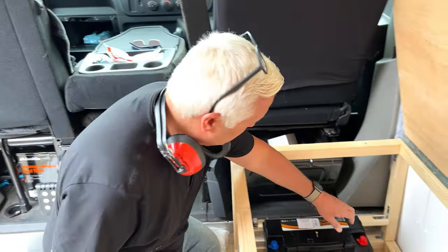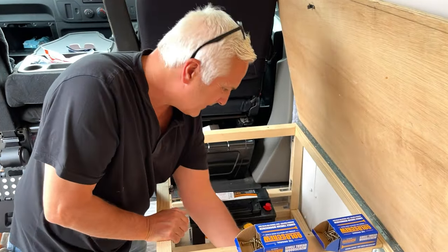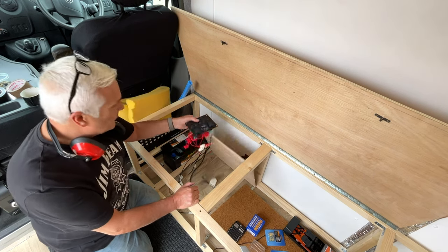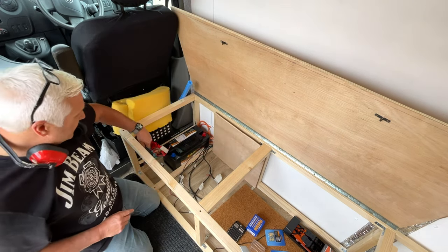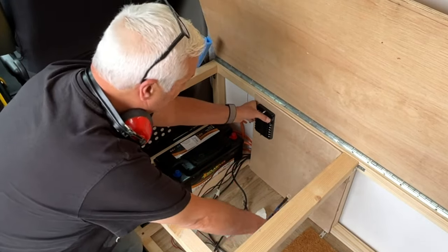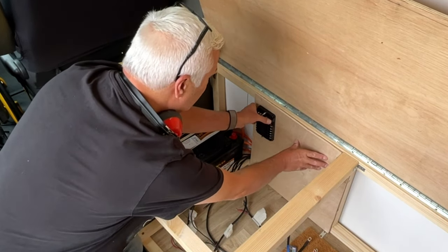It doesn't need a strap on because that battery can't go anywhere. Actually, I would put a strap on. Start connecting wires and things up now to the fuse box. So what I've got going on here - we've got the battery fixed in position. I have a switch panel which is going to go up to the front, and we have the fuse box which is going to fasten onto this board here, using these brackets I got from Halfords. When the battery-to-battery charger turns up, that'll go in next to that, so we should have plenty of room.